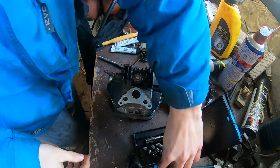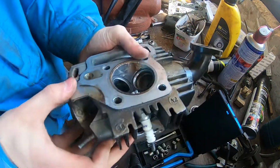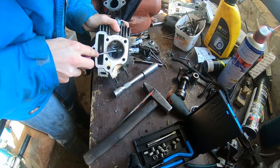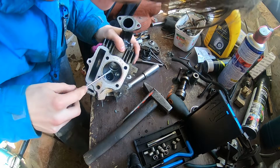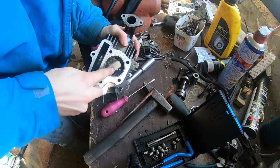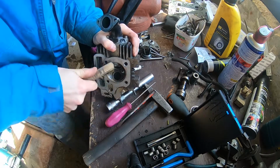This should be it. Now to remove that little installation tab. So we got it tapped, the spark plug's in, looks to be tight. So I think let's scrape off some of this carbon buildup. Let's clean the head a little bit and blow it with compressed air. And I think we should be ready for reinstall, I guess. Got my handy dandy brass brush, so I will clean this off a bit, and I think we are ready for the install.